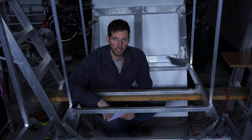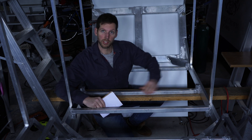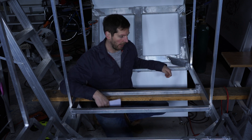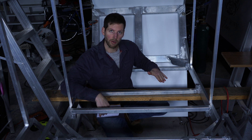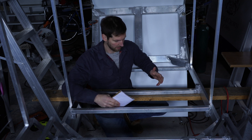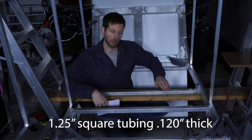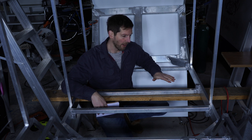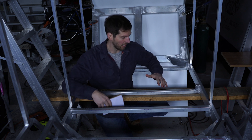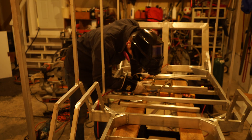I've done some miscalculation and I have to strengthen the battery support cross-members — this one in front of me and this one behind me. I was basically going to use the battery as structural support for the flooring, but what I've discovered is that the inch-and-a-quarter by eighth-inch thick wall 40-inch cross member is not going to be strong enough to support the weight of the battery and then also me lying on top. The battery is going to be about 100 pounds and I weigh 235 pounds.